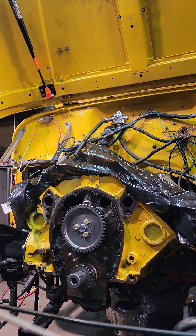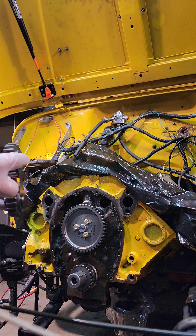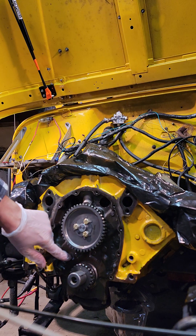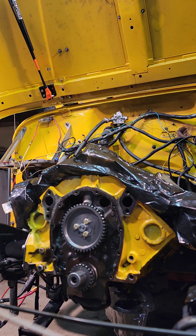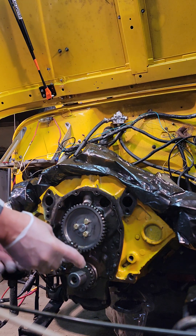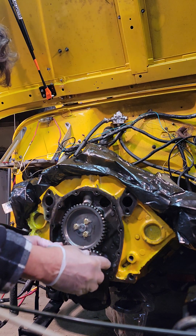So on the back side — this is the back side for the left side. This is the idler pulley here, and we didn't want too much. I probably took off a good eighth of an inch out of that. It was tapered but it ran into this little area here which protrudes, pushing the whole thing out about an eighth of an inch. So the idea is just not to squash this thing between the cover plate and the block.